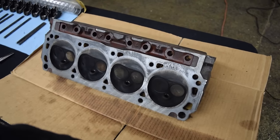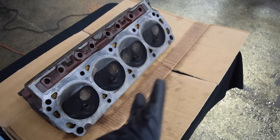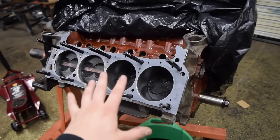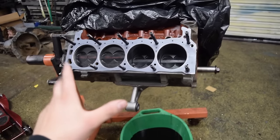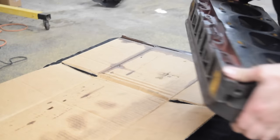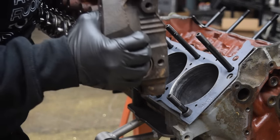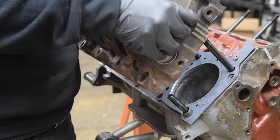This would be a perfect time to check the straightness of this head — you can do that with a good straight edge and a feeler gauge — but I don't have a good straight edge or that thin of a feeler gauge set, so we're just going to run it. The previous head gasket was not leaking and had no signs of damage, so I'm going to assume it's okay. And if you're wondering why we don't just take it to a machine shop, go watch the last three videos and you'll get the answer. Carefully going to place this two-ton piece of metal...